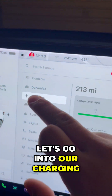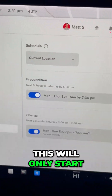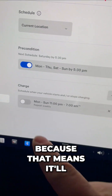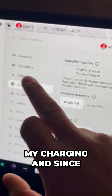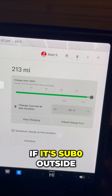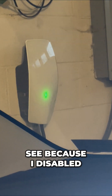So first of all, let's go into our charging. If you want to save money, create a schedule. This will only start charging at the designated hours. Why would I want to do this? My electricity company gives me a break if I charge overnight. You can see my wall connector is blue because it'll only start during this time. If I disable that, I can go into my charging, and since I'm plugged in, my charging will begin. Now I'm going to move this up all the way to 100%. If it's sub-zero outside, I like to give myself a little more charge. And you can see, because I disabled that schedule button, my Tesla has begun to charge.